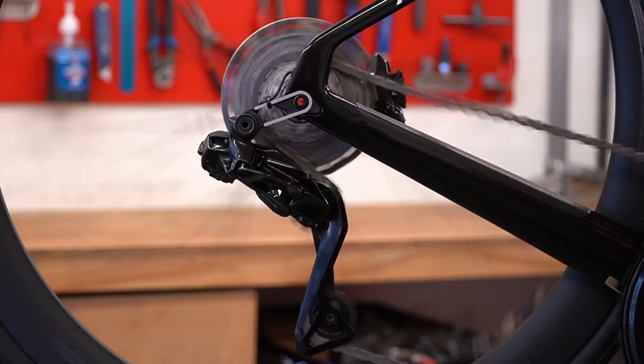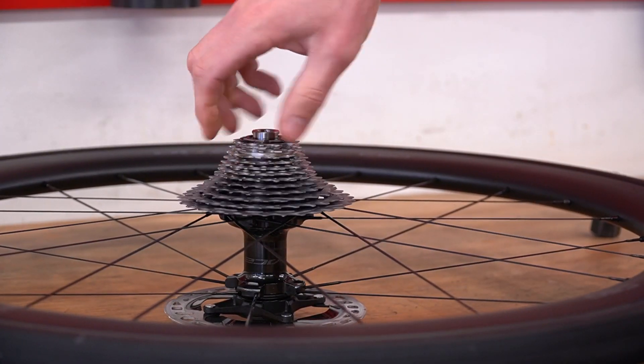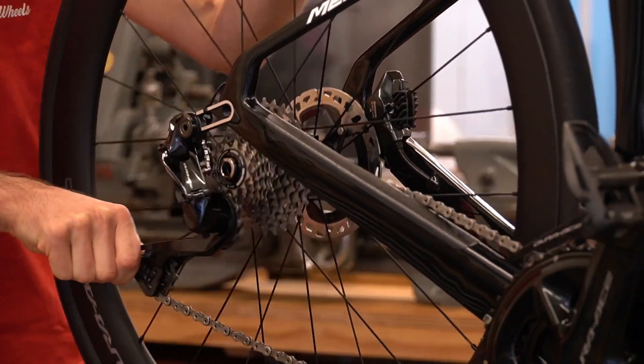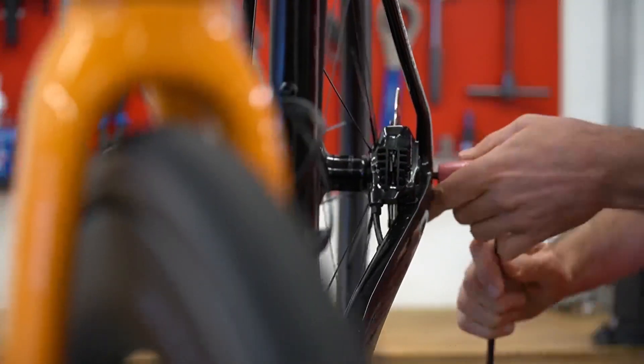It's a super exciting day here in Wellington. It's our first proper look at the new 12-speed Shimano Dura-Ace road groupset, and my first question was about the new cassette and whether it's compatible with existing Wheelworks wheels. The quick answer is yes — that new 12-speed cassette will drop straight onto your existing 11-speed wheel, whether that's one of our Wheelworks wheels or from another brand. I'm Tristan from Wheelworks. Let's take a closer look at this new cassette and freehub body and see how all this is possible.